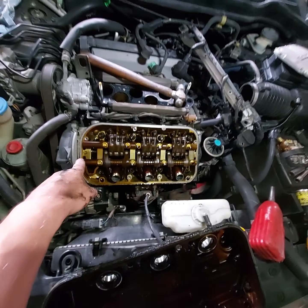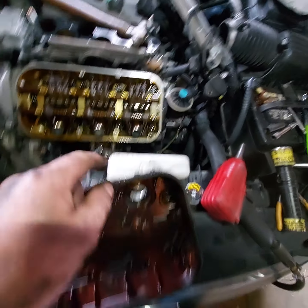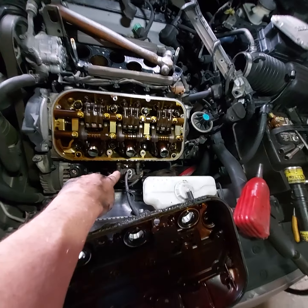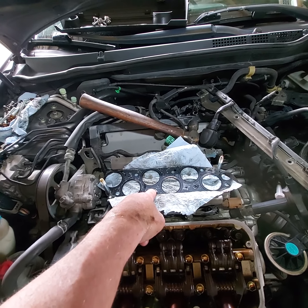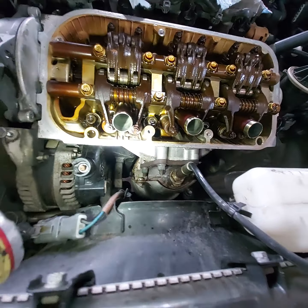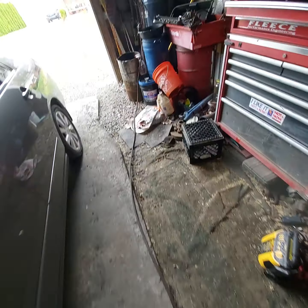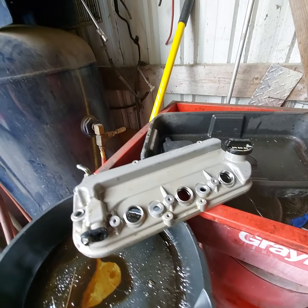We'll clean this off with some brake cleaner, clean the valve cover, and replace these O-rings on your spark plug tubes so you don't wind up with oil down in them. Clean the valve cover up nice and spray all that oil off. Then we'll change the oil on this and we'll be done. Remove the metal multi-layer steel gasket, put a blue towel under there, put the cover back on — that'll keep the wind from blowing it off. Spray brake cleaner in there and clean it all up so it'll quit smoking.